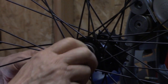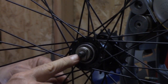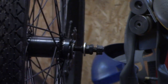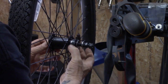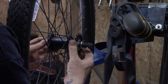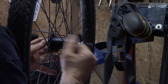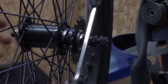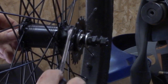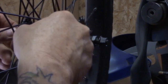I'm being very careful and only turning the axle shaft - the anchor cone is staying pushed into place. There are two tabs in there that go against the clutch cone on the inside. I'm unscrewing the sprocket away from the clutch cone on the inside. Now I'm holding the anchor cone still and putting some grease in there - you can see the bearing on the inside. There's also a smaller bearing on the outside - we're going to grease both of those up.